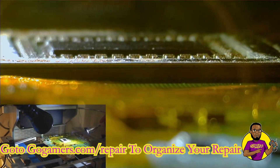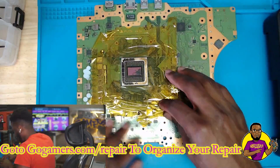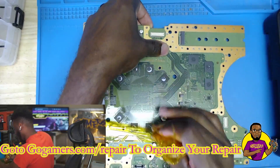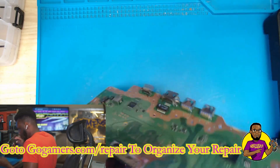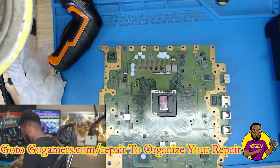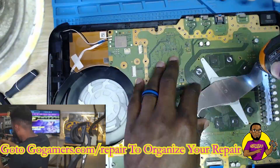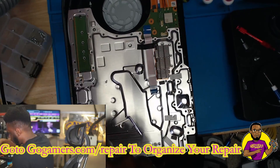Now we're removing all of the kapton tape from the motherboard and cleaning it. Off camera I actually put the whole motherboard inside the ultrasonic cleaner just to make sure everything was good. Now we're going in and carefully aligning electrical tape around the diodes to protect them when we apply our liquid metal — because if anything grounds out, the console will not turn on. I applied new liquid metal with a brush, put everything back together, and now we're going to test the console, though we still have to get through the thousand PS5 screws.